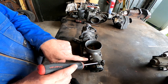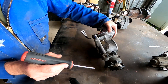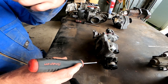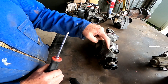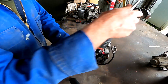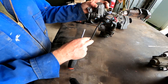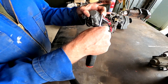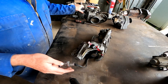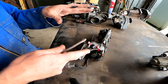Let's have a look around the throttle body. We have this piece which is the APS — accelerator position sensor — where the cable goes on. It's got 5 volt, an earth, and two signals going back to the ECU. There's your bleeder for the cooling system. On this side there's your TPS, again 5 volt and an earth, and two signals going back to the ECU — a different TPS, different configuration in the way that it works to the early TPS. If you interchange them you will have problems.